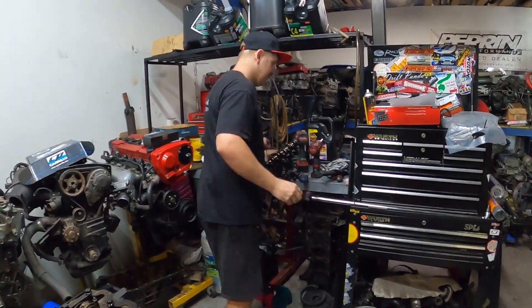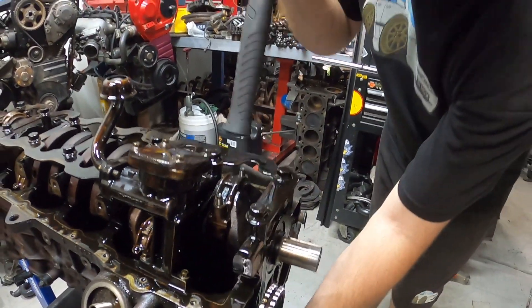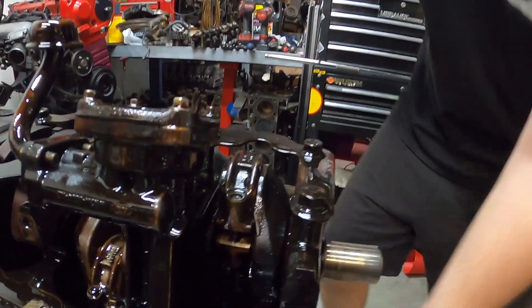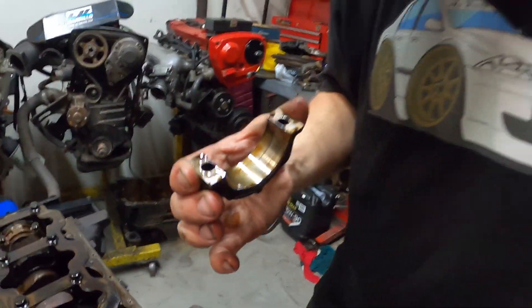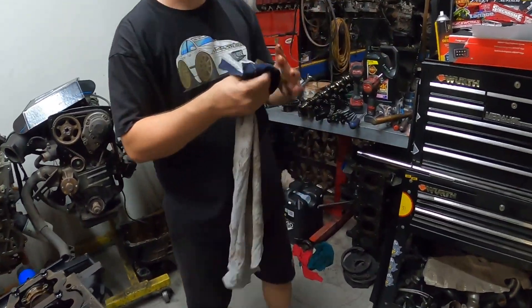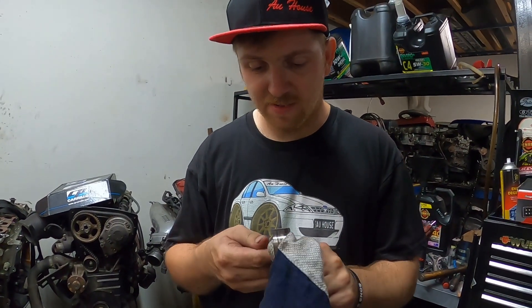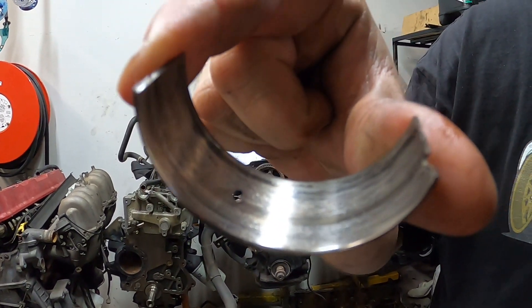Get the piston out and have a look at it. My bench has kind of gotten full but that's alright. Oh, she's going to be a long way down. This is the wrong hammer — I'll be back. Oh, has it fully spun it? I don't know if it's fully spun it. I'll get my precision tool — a bit dirty. Oh, she's... oh! How's your father? Oh man, that is thin. That is damn thin. That's squashed. My main thing — what I was saying a few episodes back — was the boost is actually squashing the bearing. That is damn nasty, that is not what you want.